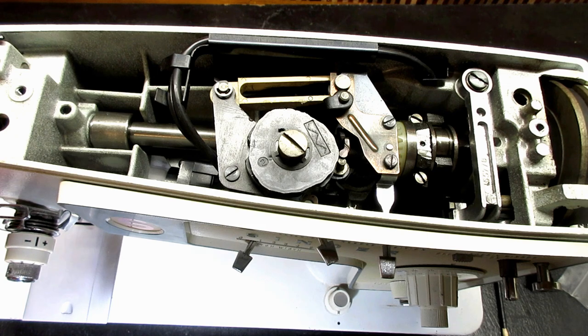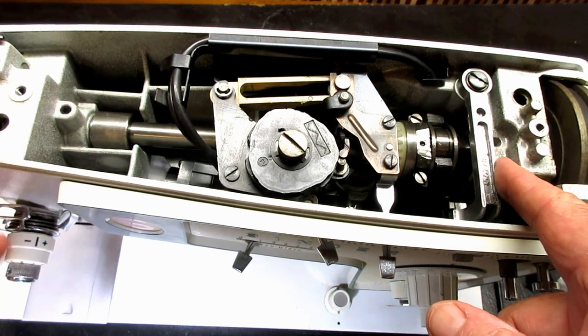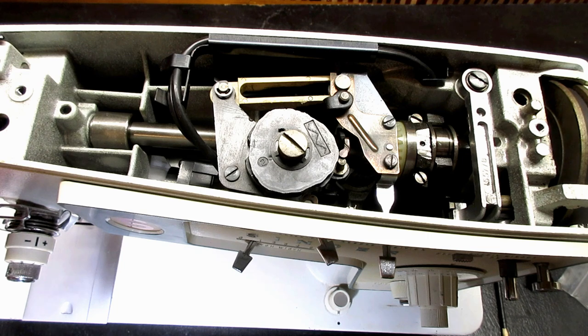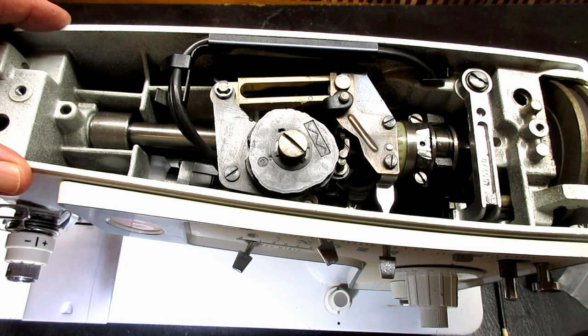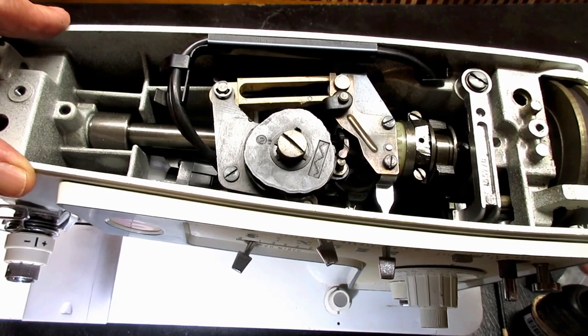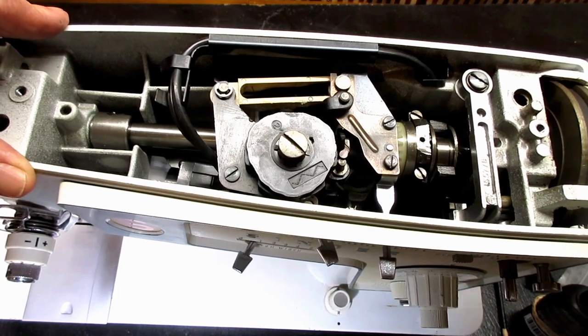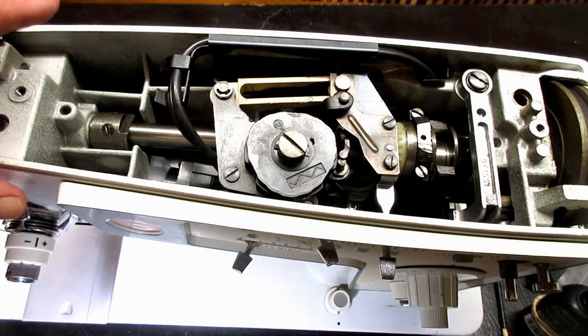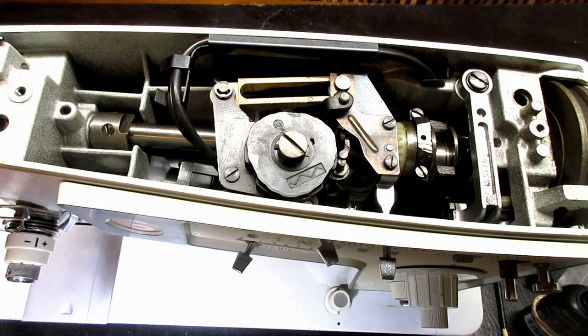And if you're taking a machine out of months or years of storage and it's frozen, those two are the first things you should oil. Because it holds more oil, but it gets in there and gets dry and just glues the shaft to the bearing. So that's usually where the machines are frozen. Okay, so we did it. 1, 2, 3, 4, and the grease back on the worm gear. Okay, so let me set up here, and then we're going to do the bushing for the vertical shaft, the upright shaft.